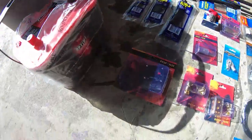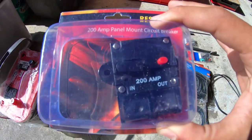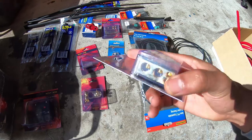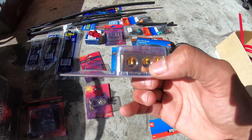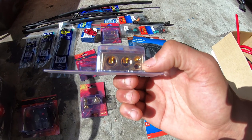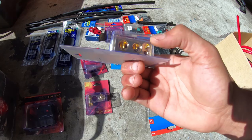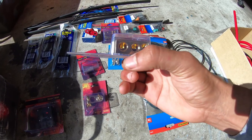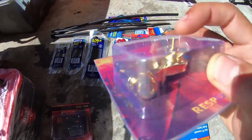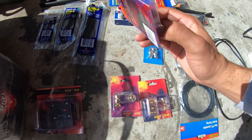The other thing I got was a 200 amp circuit breaker. I also got new terminals — the gold terminal ones — because you've got basically two provisions for your power: two big zero gauge wires plus two small accessories. I'm gonna do both my fuel pumps off of these because I'm doing power directly from the battery, then I'll have one open port plus the one going to the front of the engine bay. On the ground side I've got space for eye connectors — some eyelets, just a two-way connector.